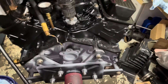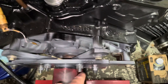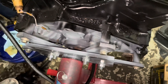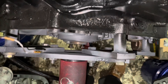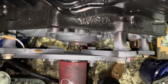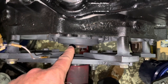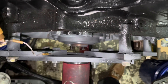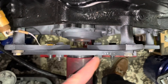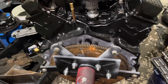In order to do that there's a trick to it. The flywheel that goes on the back of this engine would normally be required to mate with the starter so you could turn the engine over. This is a boat engine with a very heavy thick flywheel, but as you can see the flywheel is not going to fit in there because the engine stands too close. So I had the idea of taking the flex plate from an automatic transmission vehicle — the crankshaft's the same so it'll bolt up — and then I can have a gear for the starter to engage with and turn the motor over.